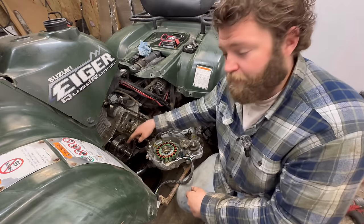This does not come with the one-way bearing in the back, so we're going to have to replace that with this one. We're going to take our six millimeter Allen head on an impact and start removing these bolts. This will pop right off. Give it a good cleaning, then we can install it on our new magneto. I like to clean off my bolts and we're going to use some Loctite so we do not want these falling off. Then we'll install it back on there.